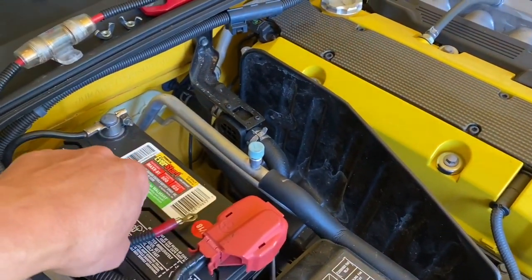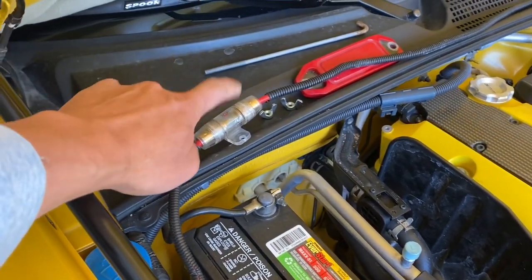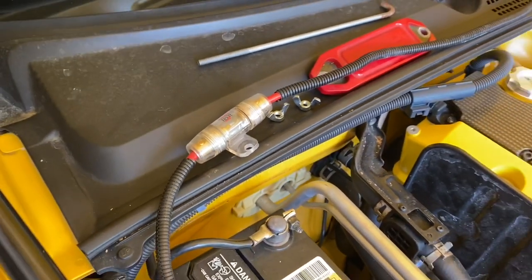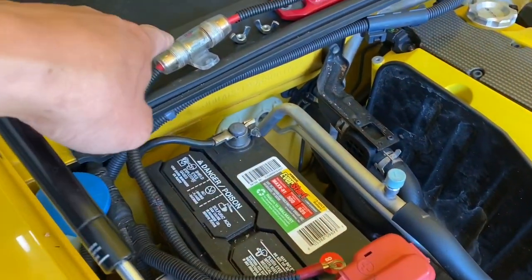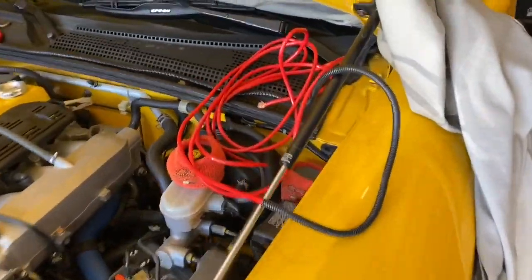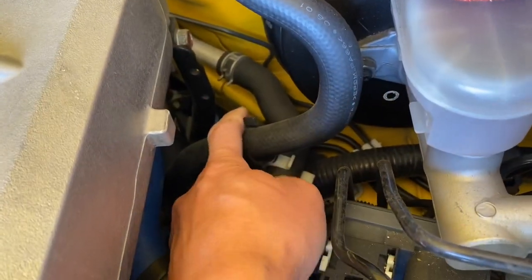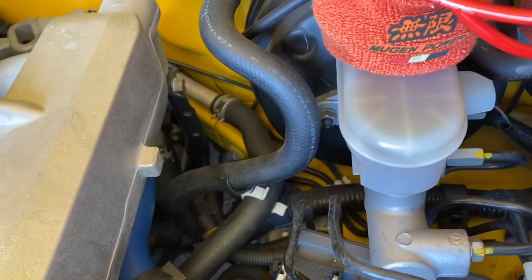The fuse is run within 12 inches of the battery. The fuse is not meant to protect the amplifier — contrary to what most people think — it's meant to protect the car. So we run the cable from the battery to the fuse, and from the fuse the wire feeds down the side of the engine bay and works its way around. We're going to run it through a factory grommet at the bottom, buried down here, into the driver's compartment on the other side.